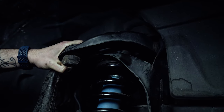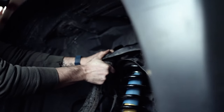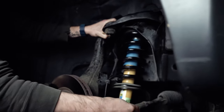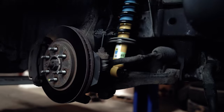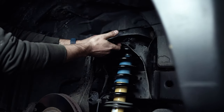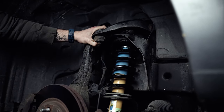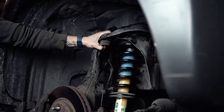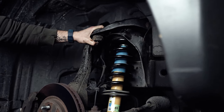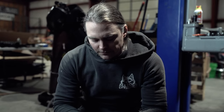On a 4600, sometimes you can get away with running a half inch spacer without having coil bucket contact, but if you're running a Bilstein 5100 — which is about just under a quarter inch longer in overall length — running that spacer with a 5100 would create coil bucket contact. The purpose here is just to show you, even with a factory piece, how close it gets with something as modest as a half inch lift spacer.